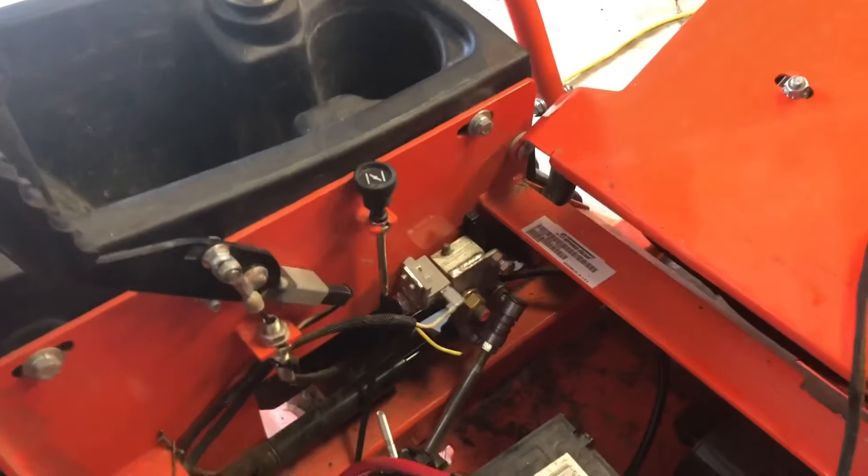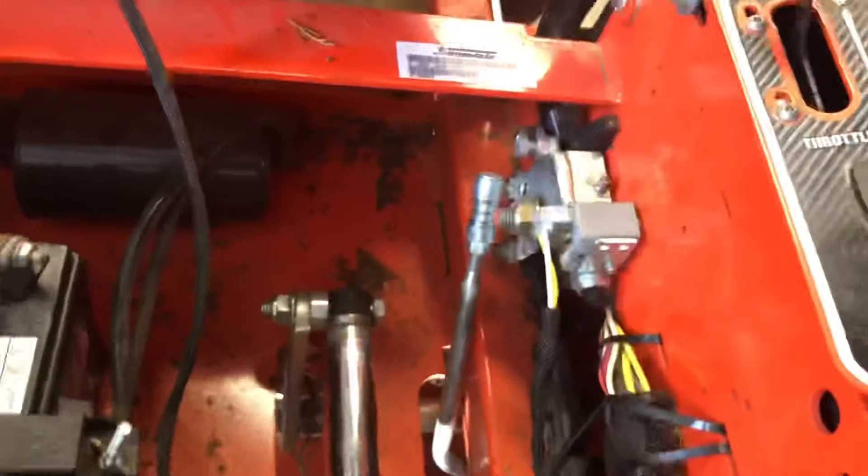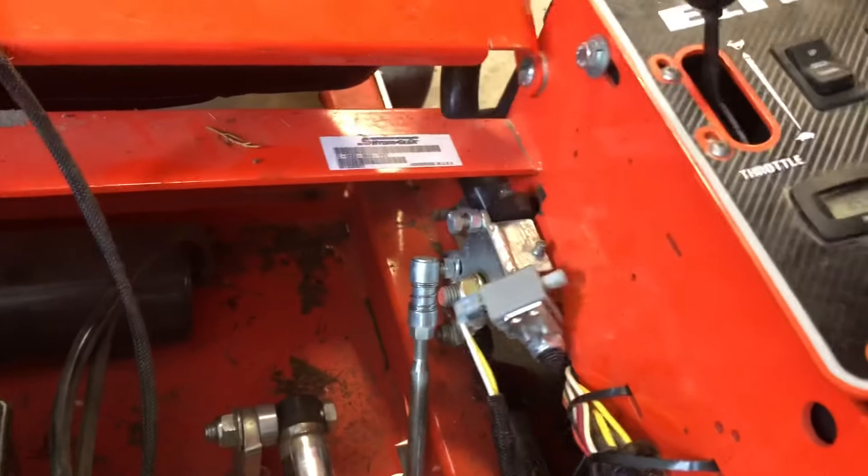You can see there's not a whole lot of wire attached to that, so I can see why that came apart. Probably need to be looking for that one too. I'm going to see if I have one of those spades - I know I got one that came with this wiring harness that came with the starter solenoid. Get that wire fixed and then see if we get ignition or spark after that.